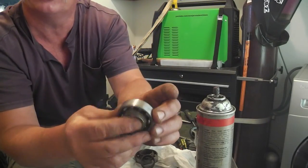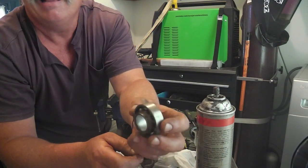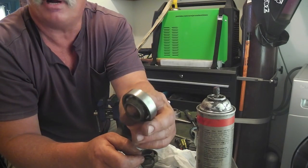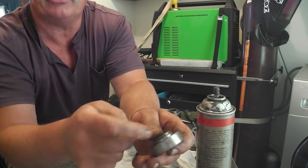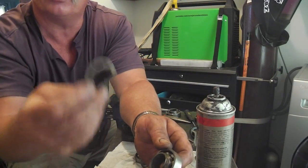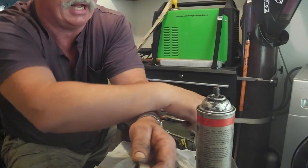These are the bearings. And I'm going to reuse these bearings. I've cleaned them out. There's six of them, two to each spindle set. So, at $20 a piece, I'm not going to buy all new. I'm just going to pluck the seals out of the back. And you can see here they are. You pluck them out. They're not really reusable. Sometimes the seals can be put back in if you get the right kind, but these aren't the kind. You just rip them out and they're gone.